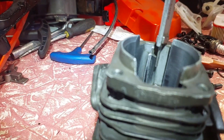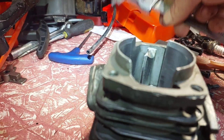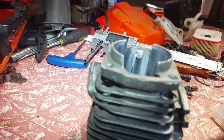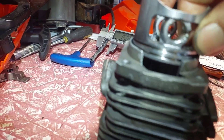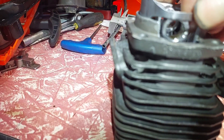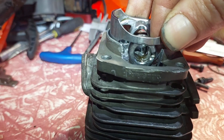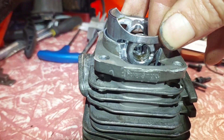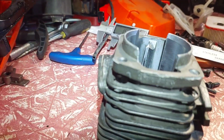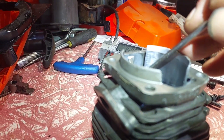I'm going to go about 15 millimetres off this edge of the cylinder. The way this is set up, there's so much more I can get out of this thing. The windows are badly covered up — the window towards the exhaust is almost completely covered. I'm going to make sure when I port this that window is exposed. The window towards the intake is open and not a problem, but the exhaust one is completely shut.